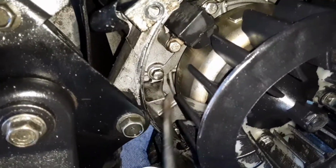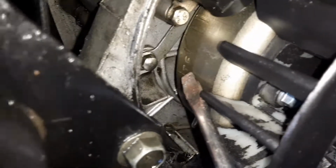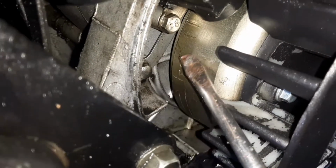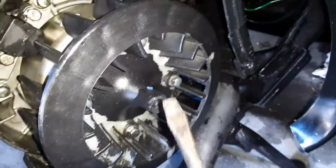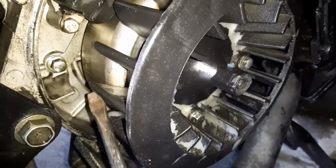So check this out. Now it's lined up. This is the lineup bar. It's a little bar right here, on top of these screws. And that lineup bar has to match up with, let me flip the camera, okay, the lower line, not the upper line, the lower line, with that. So I spun this around, see my bad paint job, looks cool though when it's on. So I spun that around in the front with the dots, remember up there, with the kickstart, and it's right there.